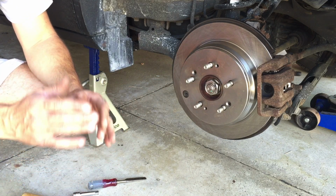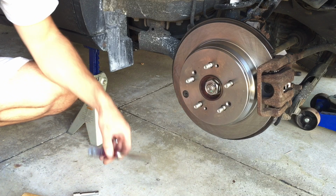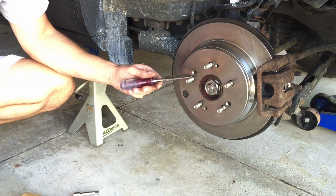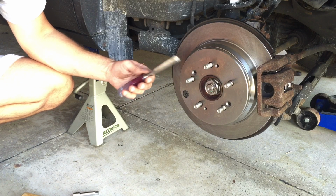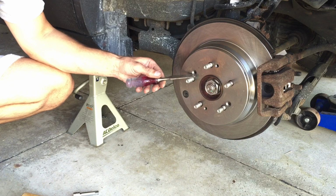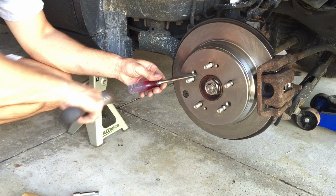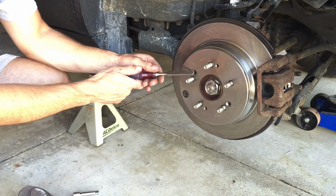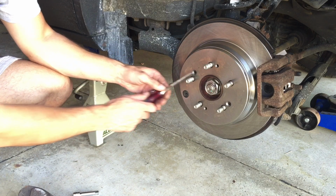And then another step you could try to take, and this is why it took me so long, is none of these worked. I used a chisel, and what you could do is take your chisel and try to come to the edge of the screw, and then hit it with your sledgehammer, and try to get the screw to basically turn by nicking the edge and grabbing it.